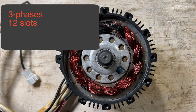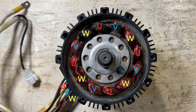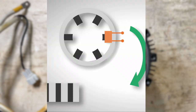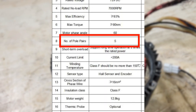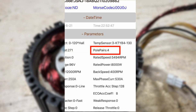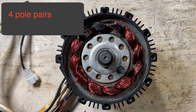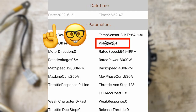Since this is a three-phase motor with 12 slots, we know that there are four coils per phase. And because this is a concentrated winding, the phase coils are distributed across the stator like this. This type of winding produces a four-pole rotating magnetic field, or RMF. This assumes a delta configuration, but we'll have to take a look at the stator from the other side to make sure. When you look at the specs for this motor it mentions five pole pairs, but this is referring to the poles in the rotor. If you're using a Fardriver controller, the app will say this motor has four pole pairs - this is referring to the RMF in the stator. But even this is technically wrong: if this motor has four pole pairs that would imply an eight-pole RMF, but we can see from the stator design that it produces a four-pole RMF. So basically it's a typo in the Fardriver app - the RMF has four poles, not four pole pairs.